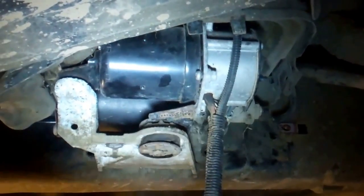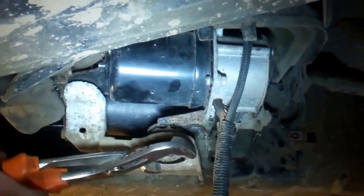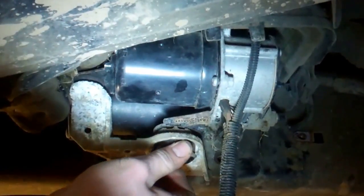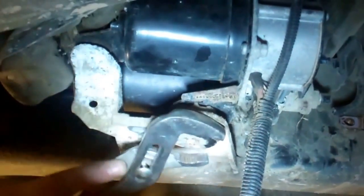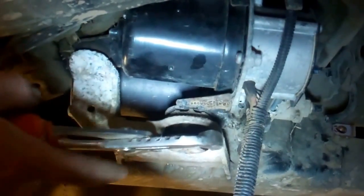You can see the compressor wobbling about relative to the bracket there, and it's on much like a radiator and exhaust. You've got a little rubber mount there. So we're trying to undo that bottom mount, because it's got to come off anyway, because we don't get a new bracket, so we're going to have to reuse these. We didn't get new mounts, did we? They ought to supply you new mounts, didn't they, with the...